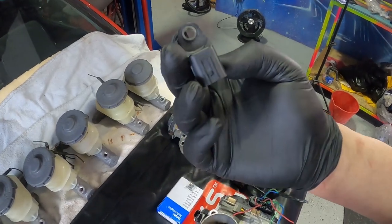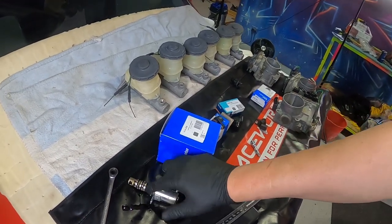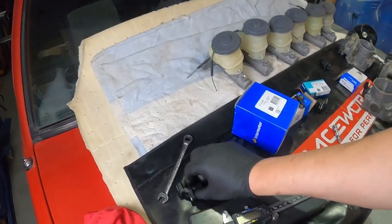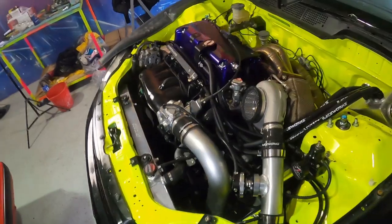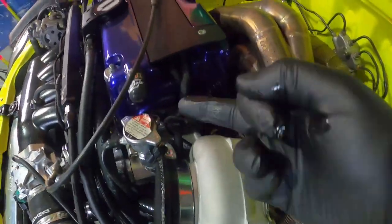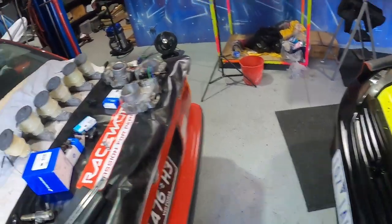Here is the intake cam sensor — it is exactly the same as the exhaust one in every single way. What I've been doing is using some oil from the first sensor I pulled out and putting that around the o-ring so it slides in without pinching the o-ring and seals a lot nicer. A tip for you: if you're running one of these brace things, you'll have to take the bolt out, swivel it, unplug it, and then pull it out — it doesn't work easily because of that being in the way.